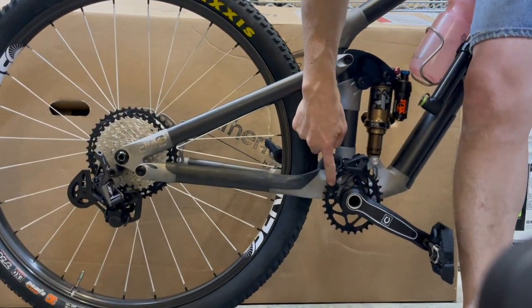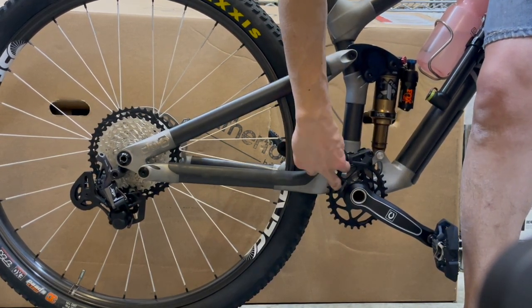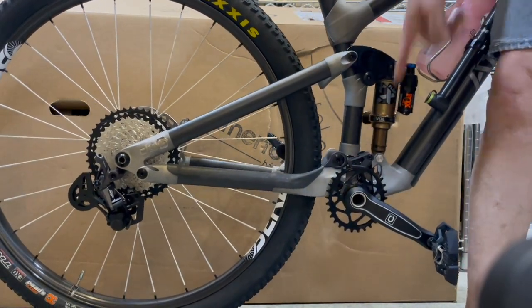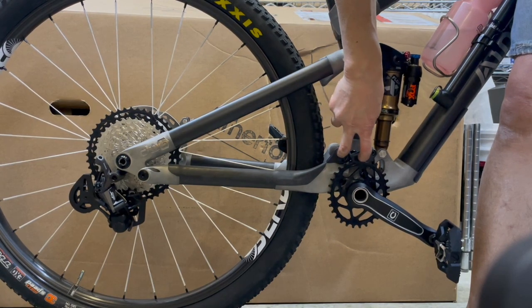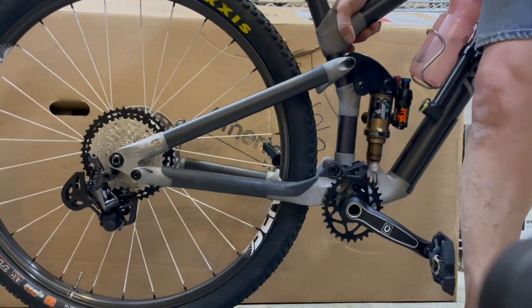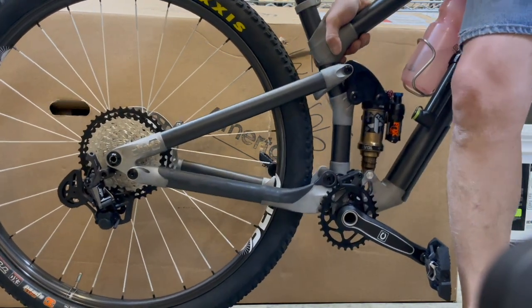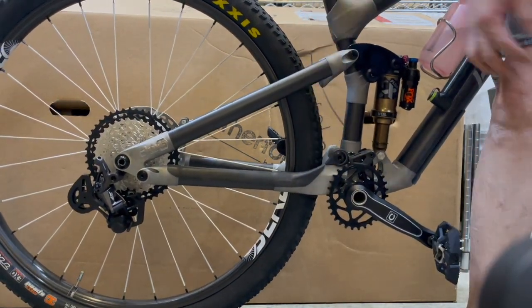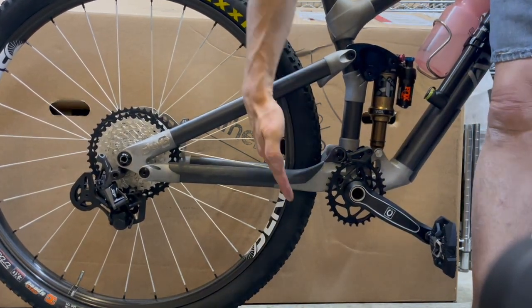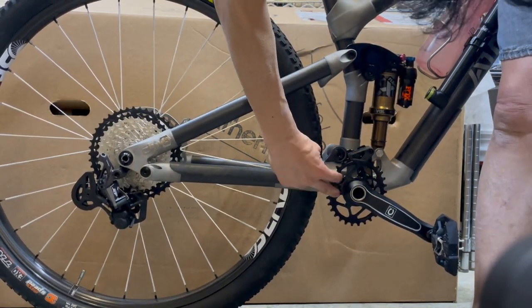You can see from here it moves away because it's a pivot on here, but there's also a linkage here, and there's also a linkage here, two linkages. This top linkage doesn't move much, it barely moves, but this bottom linkage right here moves a lot. And both of these linkages are like a saloon door, like a Western saloon door, where this bottom linkage has a pivot here and another pivot right like this.